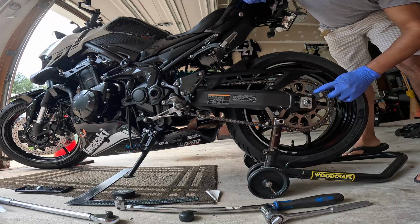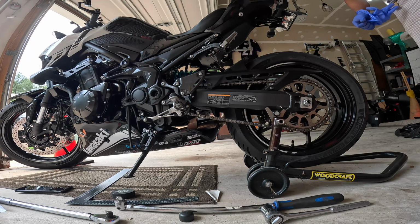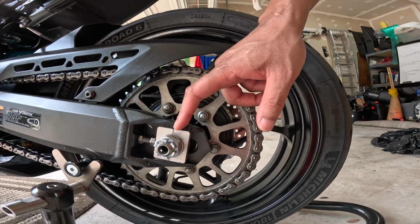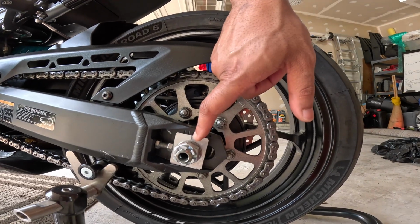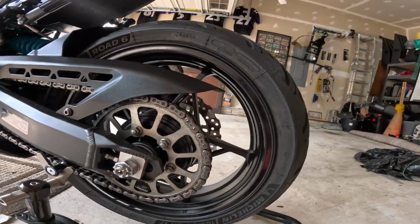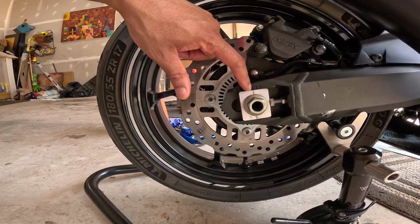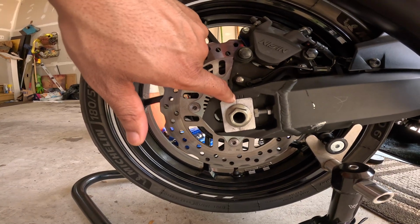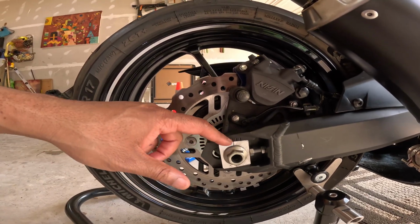And when I'm talking about measurements, I'm talking about literally a fingernail. Let me give you a zoom in. I originally thought it'd be easier to just go right to this tick mark, but that made it too tight, so I had to come in just a hair right inside of the third tick mark. And if you look on the other side, right inside. So if you put your fingernail to cover the third tick mark, the line for the wheel should be just inside.